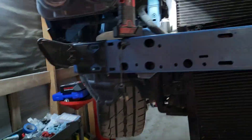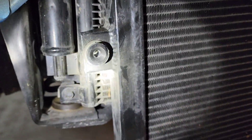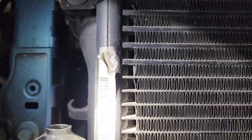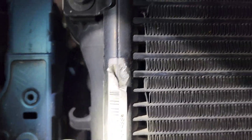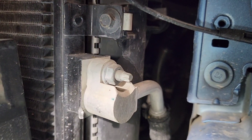I figured it had something to do with the Whipple and the heat exchanger up front — that something rubbed somewhere. Put it up on the lift with my oldest boy and he noticed it. Looking from below, we could see that the bolts mounting the heat exchanger were long and looked like they were pushing into the condenser.